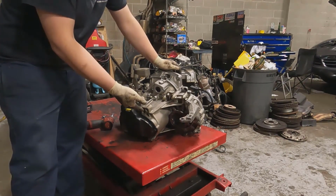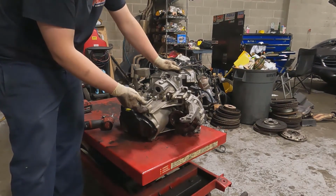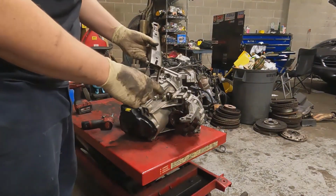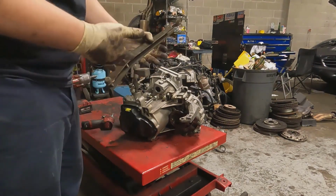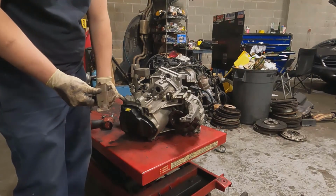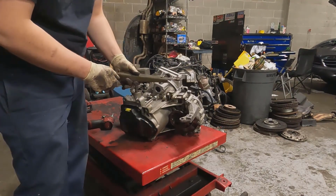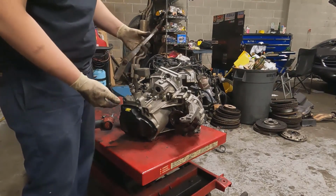Alright, so right here, on the Mark IVs, this is where the engine mount bracket goes, and there's 3/16s that go through here, and these are all threaded. So I use a Corrado transmission brace, which is this, and you can see this has bolts that go through, and there's a threaded side on the other end. Technically, you can't use this, but it's easy because O2As have this same boss, but it's completely drilled through. So the only thing you have to do to modify to get this on here, so you can actually through bolt it, is you just run a drill bit through here, whatever is like an 11mm or whatever it is.